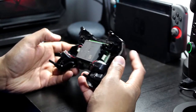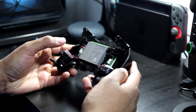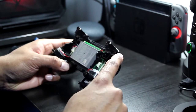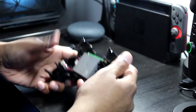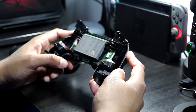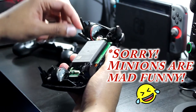So cleaning the controller fixed my issue. I just cleaned the contacts that the buttons were pressing, and I cleaned everything pretty much. And it's been working great for the past 3 weeks. But also you do want to clean it because I don't know if you can see, but I got all this dirt here along the sides, and they definitely do get underneath the buttons as well. So it's oils from your hand, dirt, Cheetos crumbs, Chips Ahoy. What? So the next step, disconnect the battery.